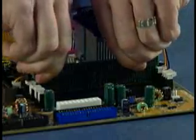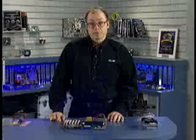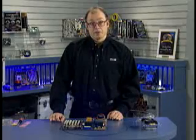To install the module, bend the plastic tabs down to either side, then insert the module with the correct orientation into the socket and push down until the side tabs engage. The DIMM is now successfully installed. At this point we've got the processor, heat sink, and memory installed, and the motherboard is ready to be installed in the chassis.